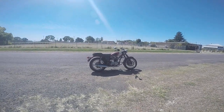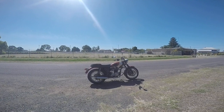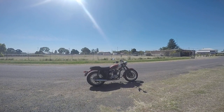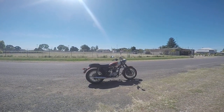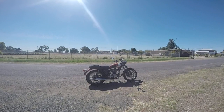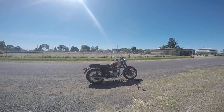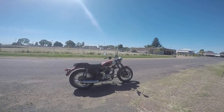I've already done this bike in a previous segment on my channel. It's a Trident frame, widened in the rear, and the engine is a Norton crank with a big bore — so it's stroked out, it's 828, or 810, I can't really remember. I've got a Harley knock-off front end on it and some Nissan calipers up front, which are pretty good on the old Harley disc, but it's a Triumph front wheel laced up.